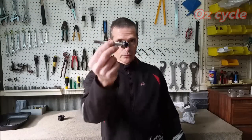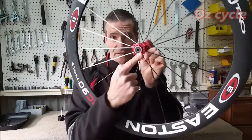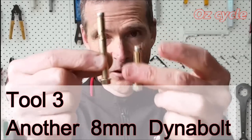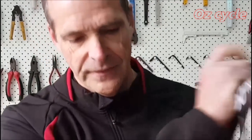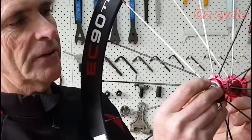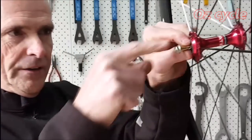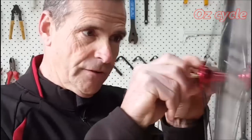What you're left with is the axle with one sealed bearing on it — you've got one out — and on your wheel there's another sealed bearing still inside. To get that one out, use the 8 millimeter dyna bolt. Unwind it, make sure it's compressed, and put it inside the bearing. Hold it with your fingers on the body and wind the nut in fairly far until you find you can't pull it out — that's how you want it.